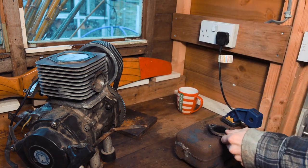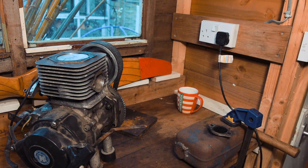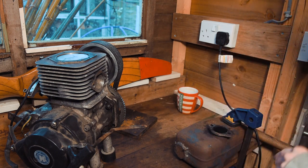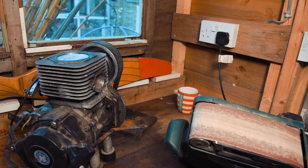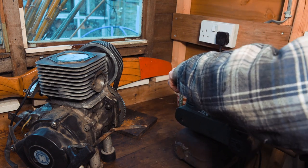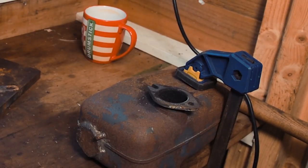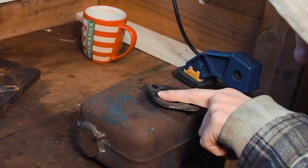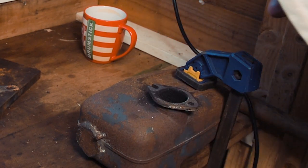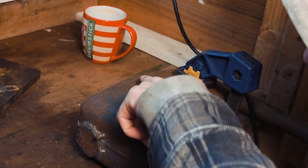We've got this exhaust nice and clamped up. The idea here is to flatten this off — the hammer is not going to do it. I could have heated that up to hammer it, but I really don't think I'm going to get this flat just by smacking it with a mallet. It's high at this point here, which is a bit you're not going to bend. So let's level this off with a belt sander. If you're doing this and refinishing a flange like this, let your sander do all the work and try and remain as flat as possible. You can already see from the shiny bits here that we've got a low point here and a low point over this edge here.